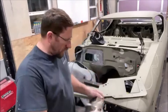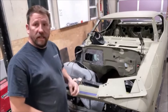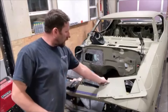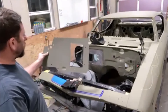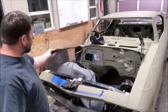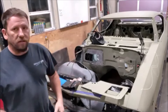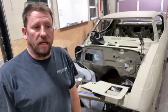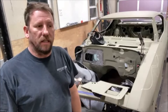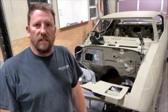I'm modifying this firewall on the 69 Chevelle here — a two-owner car for Sammy Hall. Cut out the original firewall section for the air conditioning. The hole's a lot different than this hole on this one. I'm just stitch welding here. It's a little boring, but you've got to take your time and work around it really slowly so as not to warp anything or create more work for us later on down the road.